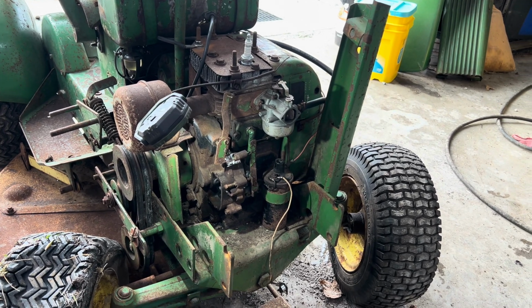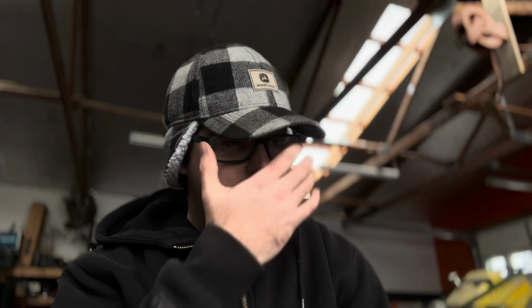In this case, I'm going to use the old points because I know it's sparked. If you take that drill bit and go into the camshaft and you don't realize it, that could be a problem down the road, because the dowel for the points is not very big. It's a little bitty guy. And if you make a big enough indentation on the camshaft, it's not going to open your points correctly and you'll have problems basically from here on out. You'll need a replacement cam. If you go too far and you somehow manage to drill through the camshaft, you're guaranteed a new cam.